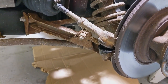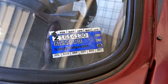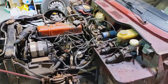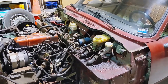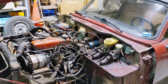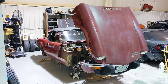The other issue is the brake master cylinder — this is probably all the fluid from the brake master just out there. Since the previous owner already did all the brake stuff except the master cylinder, I think once we do that the brakes should be done. We'll flush everything out and put DOT 5 in there so it doesn't have the corrosive properties of DOT 3. There are new soft lines as well, so after that point the brakes will be good. The rear of this car sags — not really left to right, but the entire rear of the car.